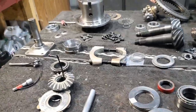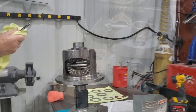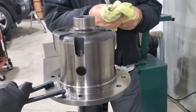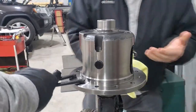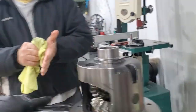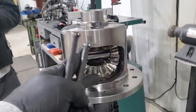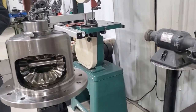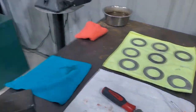Let's stack her up and see what we got with the clutch stack. We got to shim it for the correct tightness. We got our Eaton clutch pack put together without springs. What we're doing is checking the tension — rotating drag on the clutches. Instead of having springs in here continuously applying pressure and wearing them out every time you make it turn, we're going to preload it to about 40 pounds of drag with all these different shims.